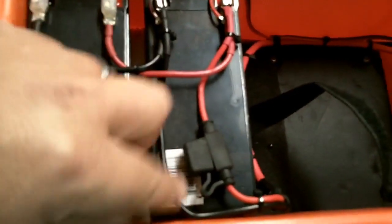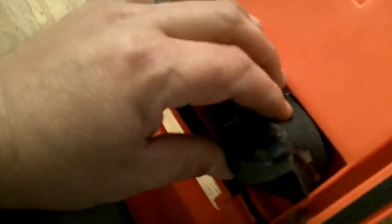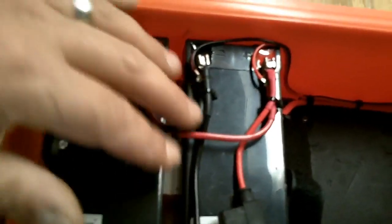The negative terminal off of battery two — same way — these are my cables running to my plug-ins, running around the side of the box up to the lid. I mounted the sockets; you can't really see them too well. I wrapped them with a bit of foam just to keep something from banging around in there and possibly shorting out something I might put inside. These two batteries are in the front of the box, nice and tight. I also added a piece of aluminum channel riveted to the bottom of the box tight against the batteries. I've got one little piece of styrofoam separating the batteries so they don't beat and bang together.